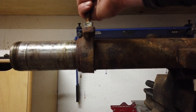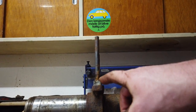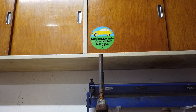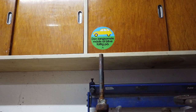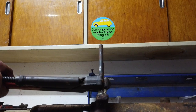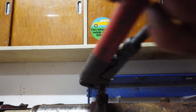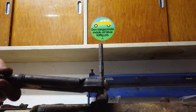Next up I need to try to extract these snapped-off studs — or rather, I actually cut them. They are going through some aluminum and then into metal, so they are just fused together. I'm going to heat up this area a lot and then grab it with pliers. And then hopefully — yeah, there we go. I'm just going to do the rest of them and take you back in a second.